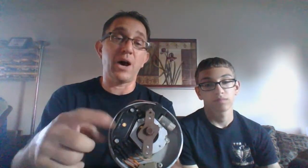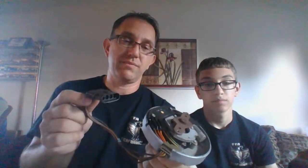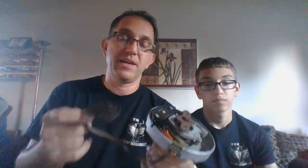Here's our 1981 distributor. Now, take the rotor off. There's no weights or springs in this. She's locked solid. There is no mechanical movement in here at all. And if you look, our ignition module gained 2 more pins. Now we're at 7. And the connector is different. There is no A to C jumping on this one. The nice part is that if the electronic spark control box goes bad, you will lose spark just like 1980, because again, the gatekeeper shut down. No more spark.